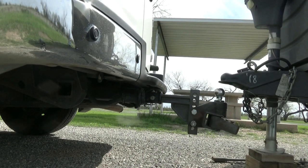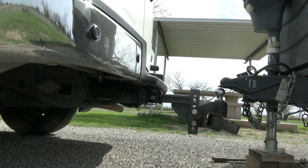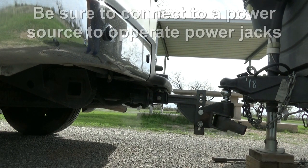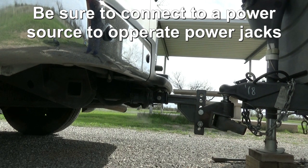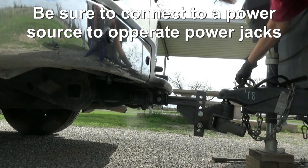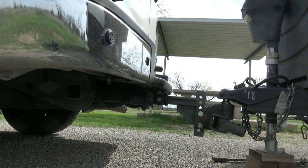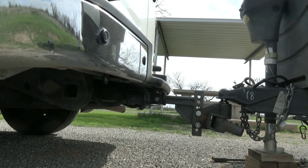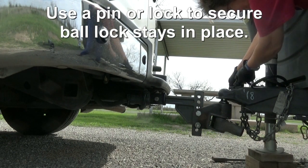Once I know it's tapped off, I can see that in my rear view camera. Then I know I'm basically there. It will probably take a couple of passes because I don't want to go too far, and I will just keep backing until I am lined up underneath the tongue of the trailer. As I lower the trailer onto the ball, you have to open up the lever on the front of the tongue, and you'll notice that the back end of the van is also lowering. Then I'm going to lock that tongue onto the ball. If it doesn't lock exactly — which happens occasionally if I'm a little too far back — I'll put the van in gear and barely let off the brake so it comes forward just a tad. Then I'm able to lock the tongue onto the ball.